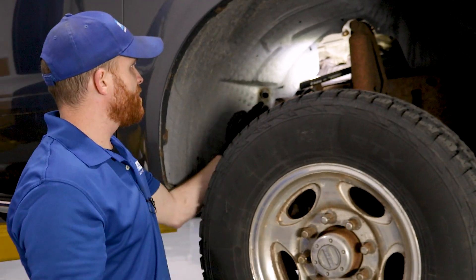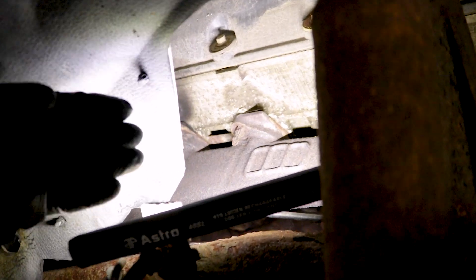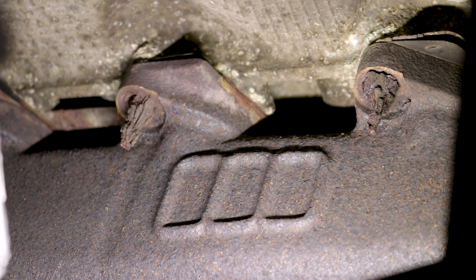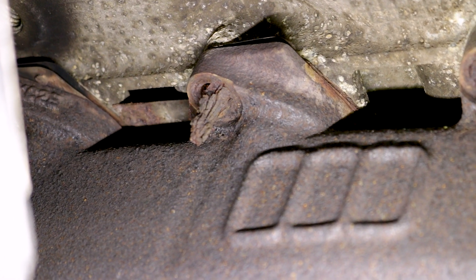For a fix, this one isn't necessarily gonna be the easiest. Unfortunately you're gonna have to remove all the existing studs inside of the engine. When you do that you'll have to get the manifold out of the way, and when it's out inspect it to make sure it's not cracked. When you try to remove these studs, they're typically not gonna pull right out — more than likely they're gonna break off. If they break off flush and level with the engine, you're gonna have to drill and tap. When you drill and tap, be very careful because those studs don't necessarily go straight in — sometimes they go at a little bit of an angle. If you're drilling straight when it's supposed to go at an angle, you could potentially drill into your coolant jacket and do a lot of damage to your engine. One thing about this problem compared to the other two: it isn't necessarily gonna cause any runnability issues, so you can technically drive it, but having an exhaust leak ahead of the passenger compartment isn't something you wanna do for a very long period of time.